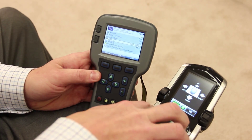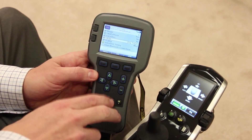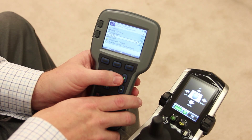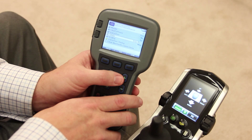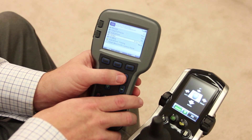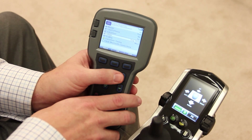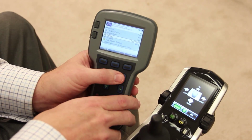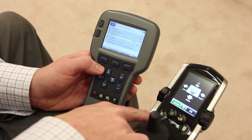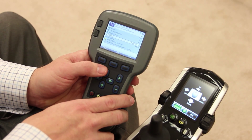Key toggle allows the one and two buttons on the hand control to toggle between mouse movement on the screen or mouse clicks on the screen. Key auto is the same as key toggle but automatically returns to mouse movement after a mouse click is achieved. Key hold is similar to key toggle but mouse clicks are only active as long as the one or two key are held down. Key one and two turns the one and two buttons on the hand control into your mouse clicks — this is the most often used by most folks.